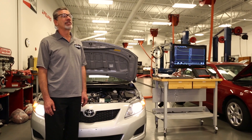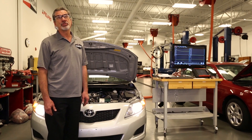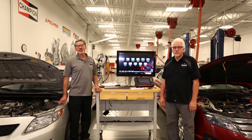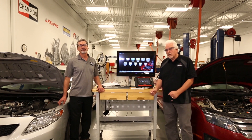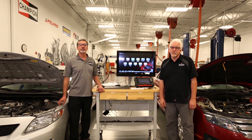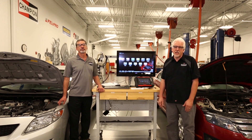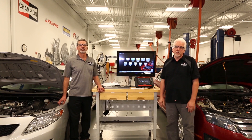This is a great asset in helping us get the best fuel mileage and the tightest emission control. As you saw from our earlier demonstrations, there's a big difference between the conventional oxygen sensors and the wide range air fuel sensor systems. The more understanding you have of these, the better off you're going to be. Toyota makes it easy to test their air fuel sensors — they have a test built into the scanner that you can use to test sensor performance. You can command it rich and command it lean and get the results.